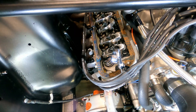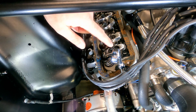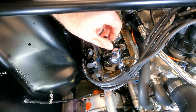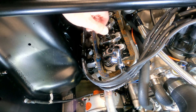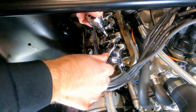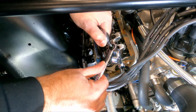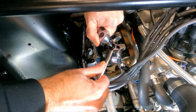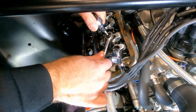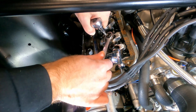Now I want to go in and re-tighten the set screw. Just go ahead and run this all the way to the bottom on both of them. Now we're going to want to hold that jam nut in place while we tighten this set screw. And that's one — and that's two. Great, so now cylinder number one is done.